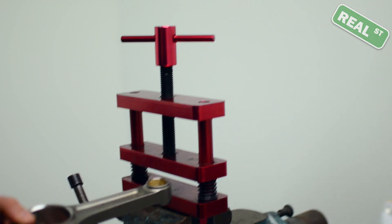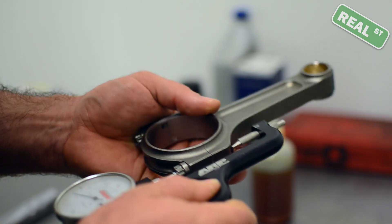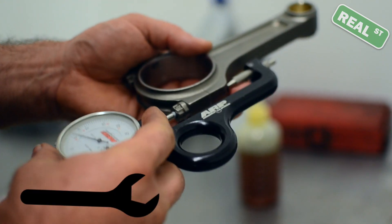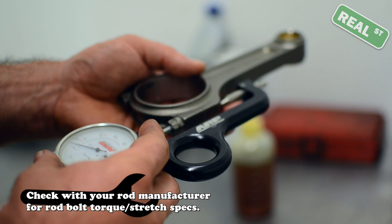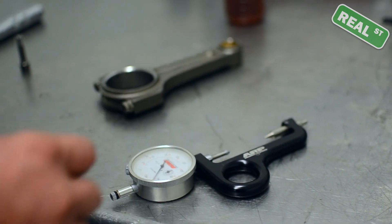In the engine it's a little bit different dynamic, but we're just doing this on the bench. You can plop the torque stretch gauge back on and check and see where you're at for stretch. This is 6.3, 6.7 — we're at about 6.2 there. So we're going to call this particular bolt and this particular torque reading pretty accurate.